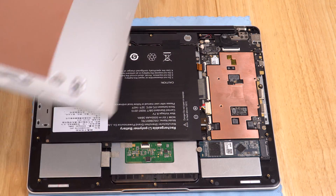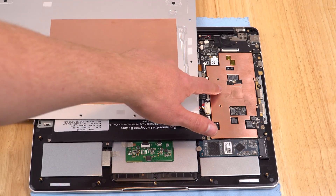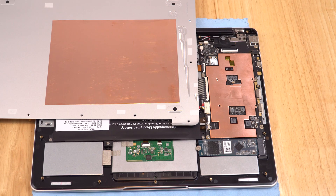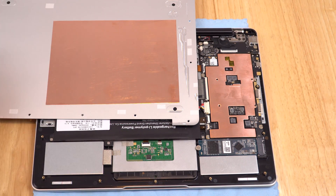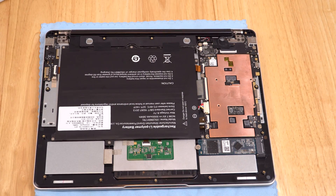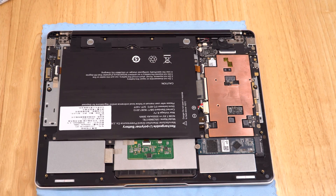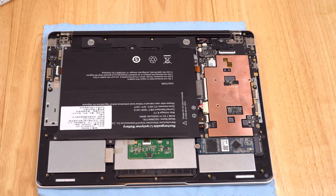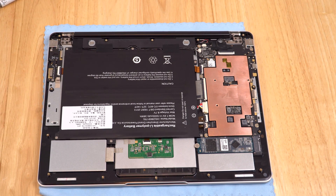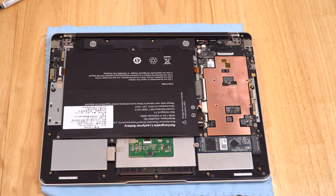What I think they could have done to help reduce temperatures is put a thermal pad on the underside — there's copper film on the back — which would transfer heat away from the chipset onto the whole rear of the device. The trade-off is the bottom will get hotter if used on your lap, but for long gaming sessions of two hours it already gets very warm and hot to the touch, so I don't see it as too much of a con.